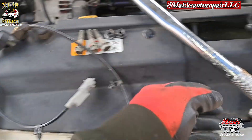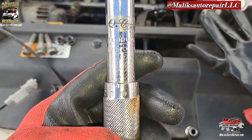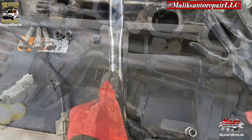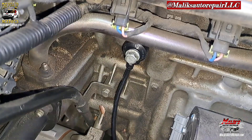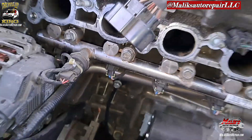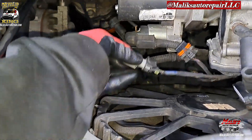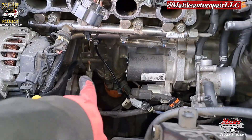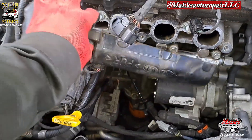So we can get it right. This is our torque wrench, got it set to 15 foot pounds. All right, we got it torqued down, nice and tight — 15 foot pounds. You'll hear it click. See I got that plug — plug back up. Everything in reverse order. Make sure you reinstall the insulation.